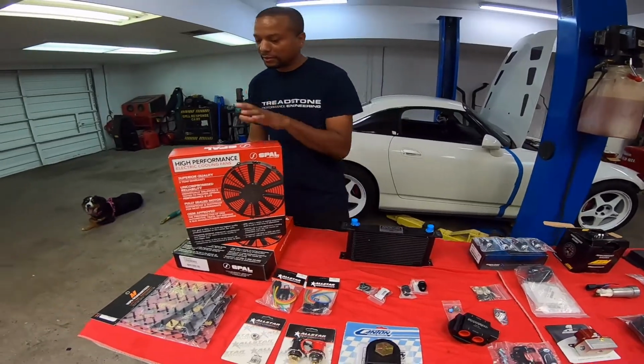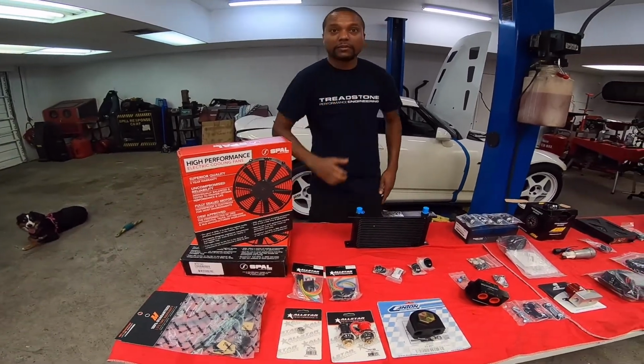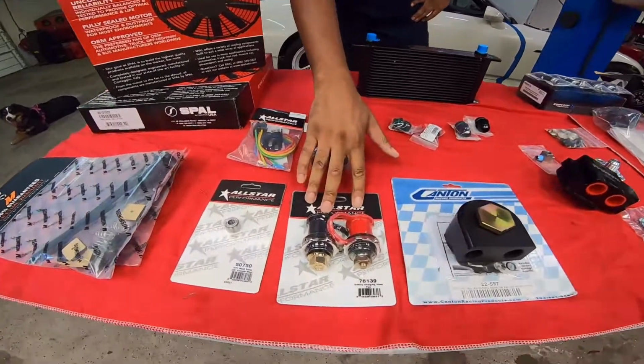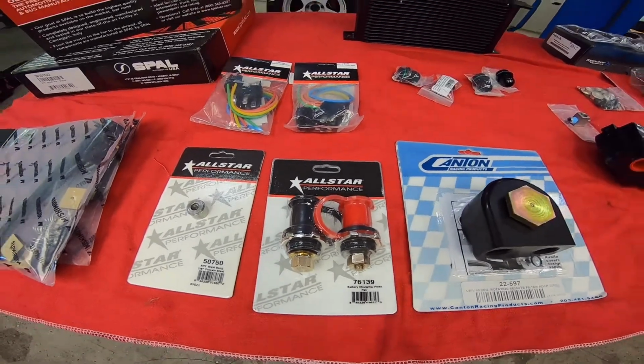We're going to mount them directly to the radiator using this install kit and rewiring them with relays to the battery so you don't burn the factory wiring up. We're also going to be adding some jump posts under the hood because the car has the battery in the back and has no keyhole, and you can't open the trunk if the battery dies.